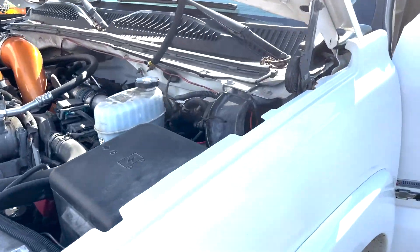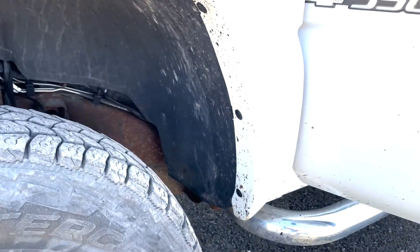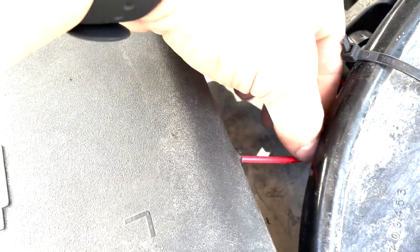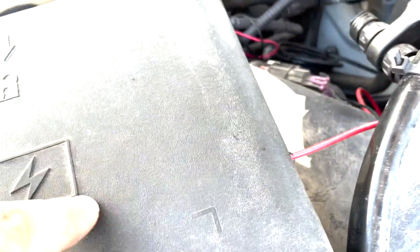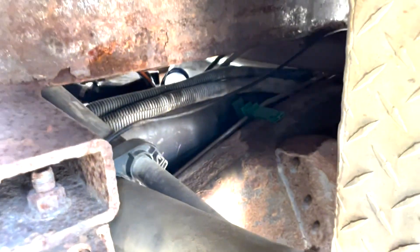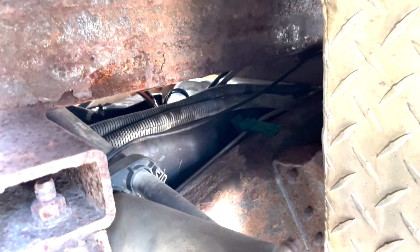Got this thing finished up here. I was trying to video me bringing the wires up — they're just behind this fender well. Here's your power wire and your ground going to the battery. Here's that add-a-fuse going to an ignition source. That's where I mounted the relay. And there's the pump right on top.